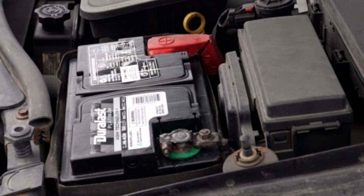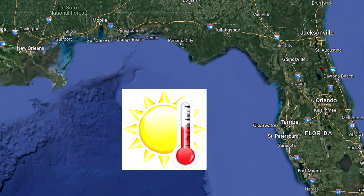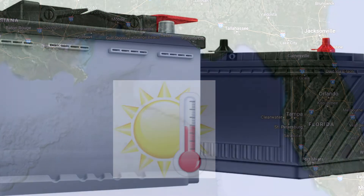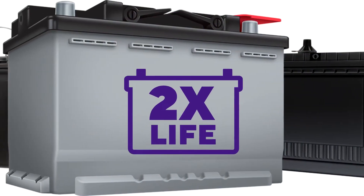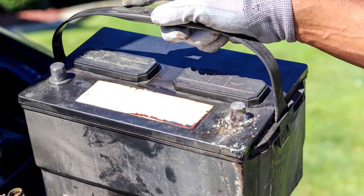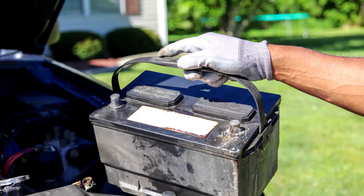The leading cause of battery failure is heat. Folks in the extreme south of the United States are all too familiar with this — they're used to changing their battery every two to three years. While upgrading to an AGM may extend the life of your car battery, extreme heat due to proximity to the engine or high ambient temperature will lead to accelerated corrosion and shorten the life of your battery.